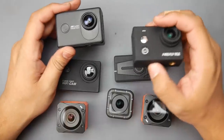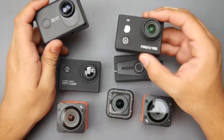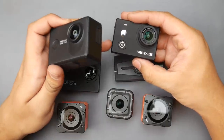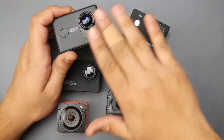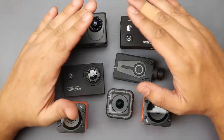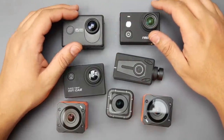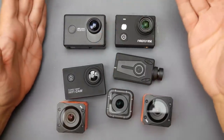This might be a rebranded Hawkeye Firefly — they perform just about as good. This one is slightly better in terms of bit rate, at a static 50,000 kilobits per second, while the Firefly caps around 35,000–40,000. The overall image quality is slightly better here, though I find the Firefly a bit sharper. Both were tested at default settings, 1080p 60fps, and both are capable of 4K 30fps.